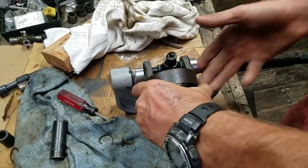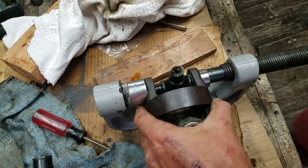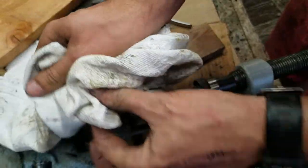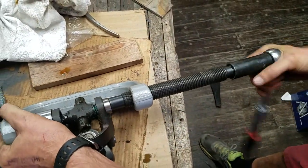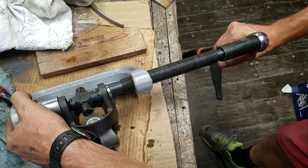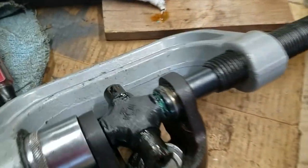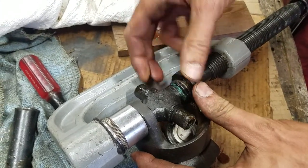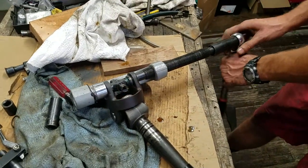Position this in the screw clamp. See how nicely that socket fits over there — that's going to allow the housing to press in. You want to do this by hand so you can feel if something's going to go wrong. Usually it doesn't take too much. You can see how nicely it's just going in. I'm going to go a little further so that groove is nicely exposed, then pop in my first clip. You can grease the clips as well — it just makes taking them off easier.